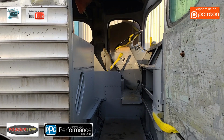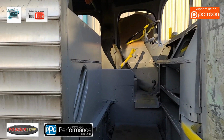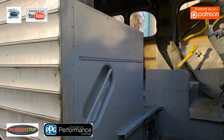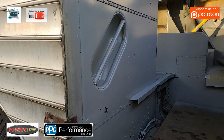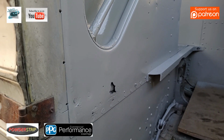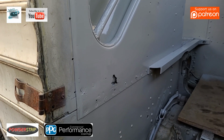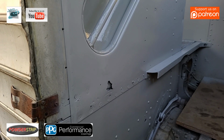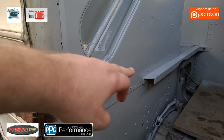Now you have it where everything's primed, and these are all commercial paints by PPG. It is actually a little bit cheaper than a traditional automotive paint. The tradeoff is the type of paint you put on top is a single stage paint. It's not going to have as high of a gloss as a traditional automotive paint, but the paint's going to last 20 plus years.